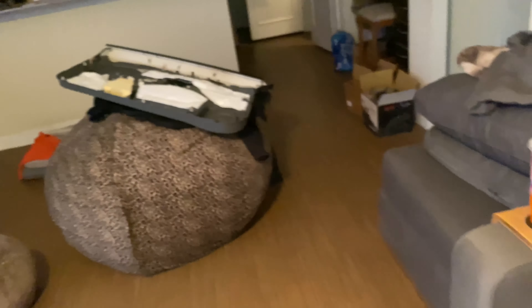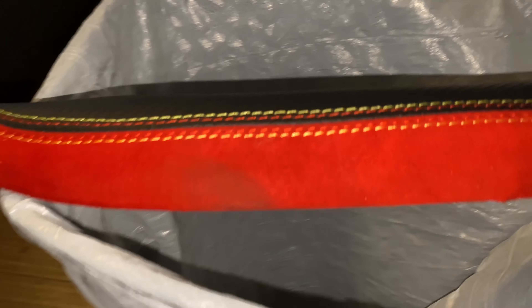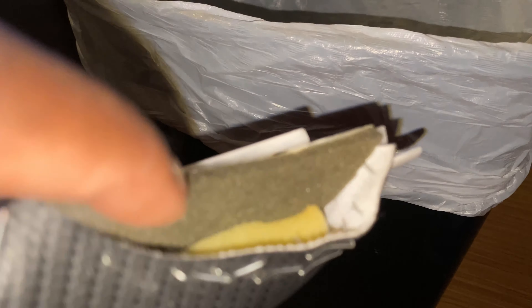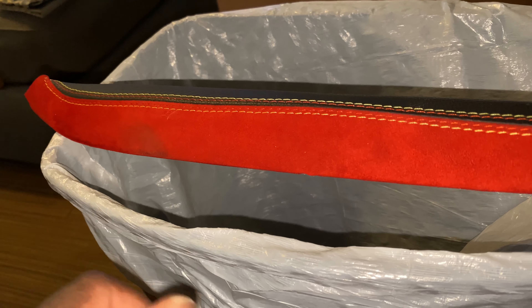Got the stock one and the carbon fiber one — there we go. All we've got to do is slide the buttons underneath here — they don't sit flush, they go in like that. I'll swap that out and simply reinstall in reverse. One important thing: the screws in here are small — don't use an electric driver, use a manual so you don't strip the screws, because if you strip these screws, you're screwed. Place it back in, put the two screws in, lock it back in place, make sure the little hooks go underneath, and put the panel back together. Driver door is done.